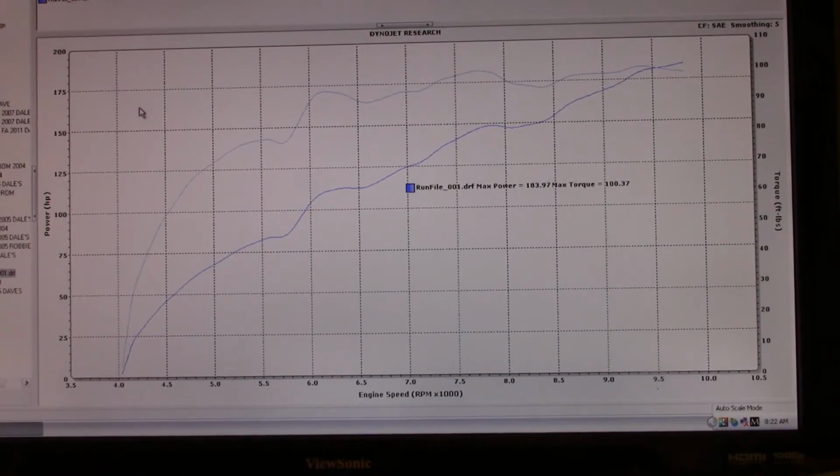But all through here, I've started the dyno. Let me use the little cursor. I started the dyno here, but see, I'm going very easy on the throttle right here, getting ready, and then right about 5,500 is where I roll into the throttle. This is in 4th gear, okay, and then it starts. This is the torque. So yeah, it made, oh geez, a little over 100 foot-pounds here at about 7,600 or so, and then it made it up here too. Okay, horsepower curve looks pretty good.